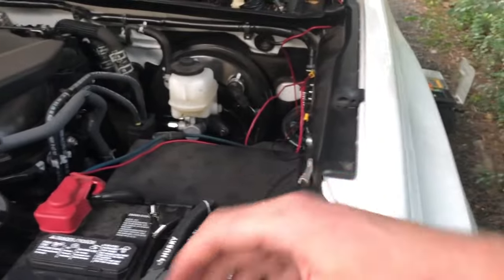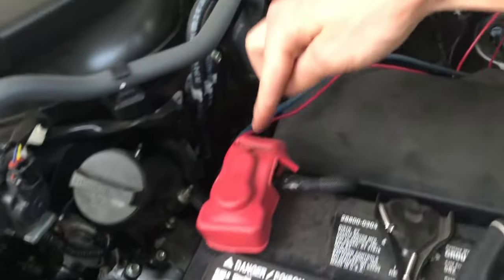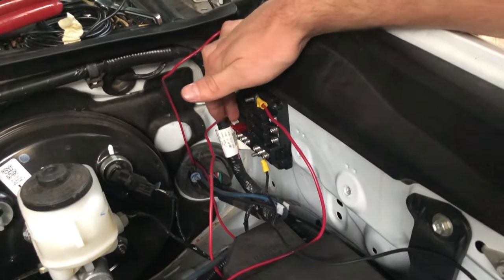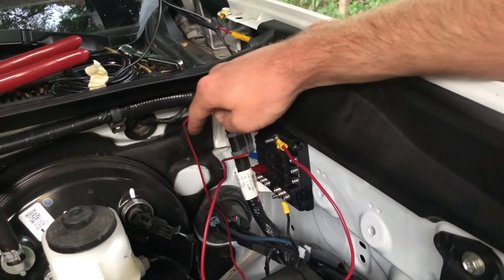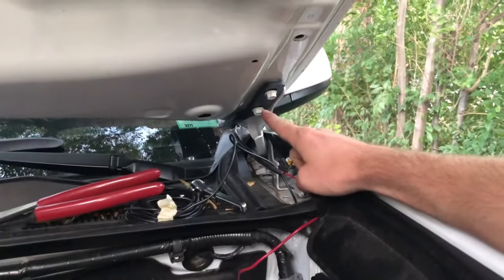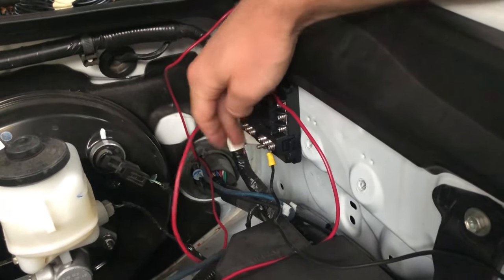Here's a quick review of the entire system. We have the power connected right here with my subwoofer, and the cord goes all the way through to the positive terminal. I have six different terminals for six different accessories. I have a 10 amp fuse for my driver side ditch light. The wire goes through the firewall up to my switch panel, then up to a single switch, comes back all the way up to my light, back through the negative side. I have it grounded here, but I could ground it on one of the six negative terminals if needed.